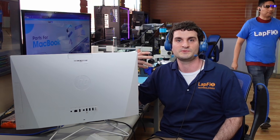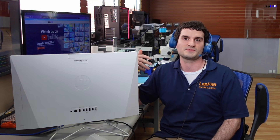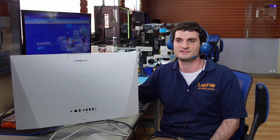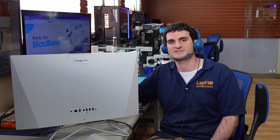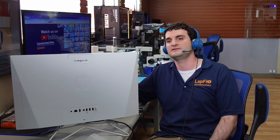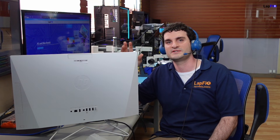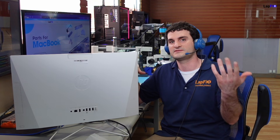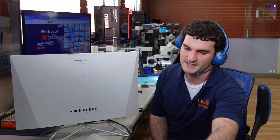Sometimes it's not plausible or some stores don't carry the OEM adapter. We understand that's why a customer might buy a third-party one, or maybe they just don't want to get an HP one — maybe it's a little cheaper. It's only a 65 watt power adapter for an all-in-one desktop, so maybe they don't want to spend a whole lot. But what we're thinking is it probably needs an HP adapter. There's that extra smart pin element, and that requires you to get a genuine HP AC adapter. So I actually just pulled one back here — I got this from an HP Omen. It actually has a blue tip and it's a 200 watt, and I'm converting it over to a barrel connector, but it's original HP.